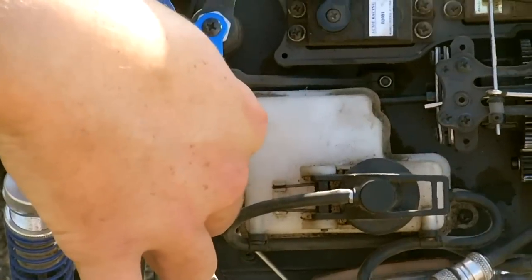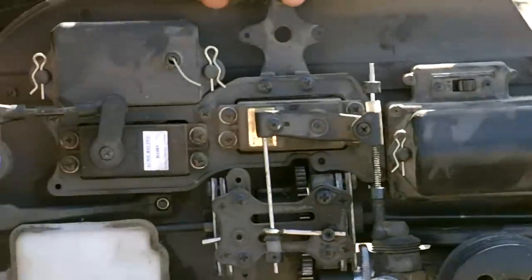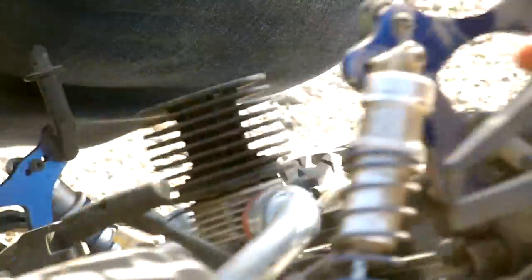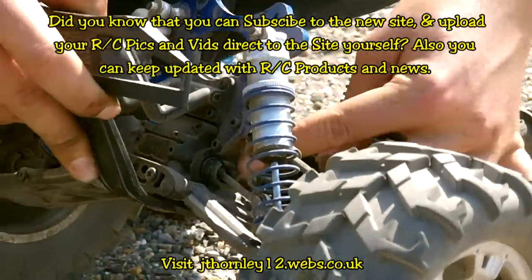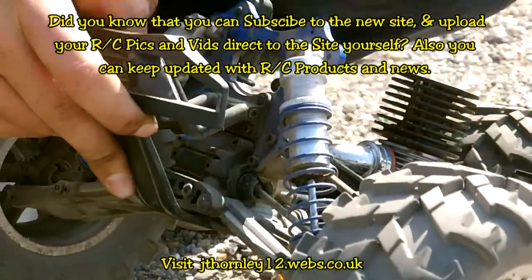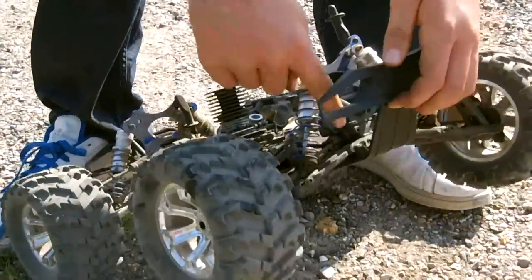At the front and rear of the vehicle you meet two more gearboxes — the rear gearbox at the rear and the front gearbox at the front. Looking at this, it's exactly the same as the central gearbox: the center gearbox also has two drive cups on each side, which then meet the dog bones, which then meet the wheels at the rear.